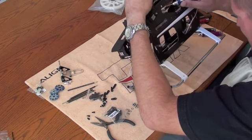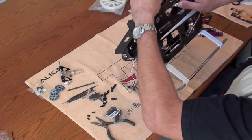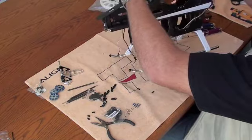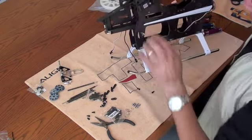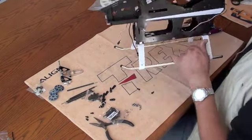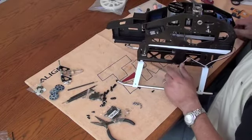Okay, tighten that pinion up, get it tight. Alright, we want it tight, and I didn't use Loctite. The reason I didn't use Loctite, because when that thing gets hot, your Loctite becomes lubricant. So, but what I did do, like I mentioned, was I left a gap. It's pretty hard to see it, but what I'd like to do is, let me see if I have something.